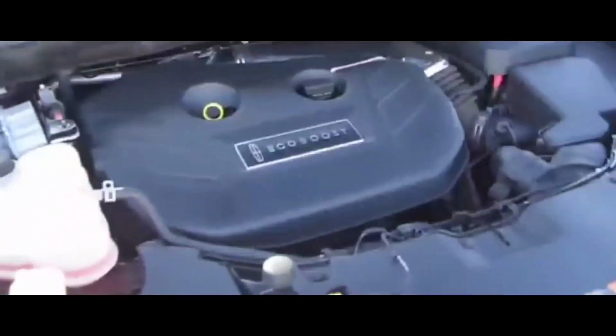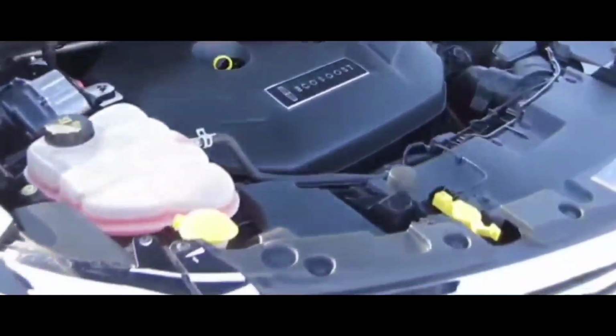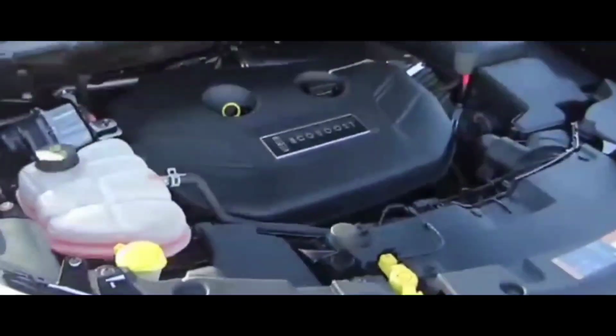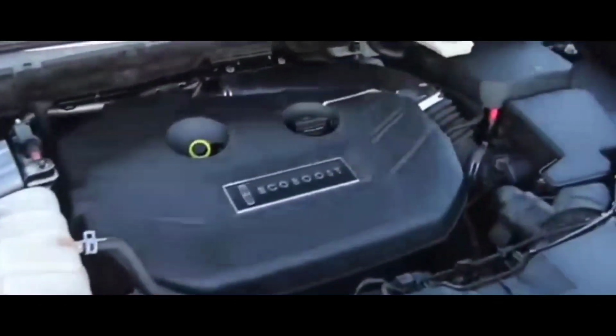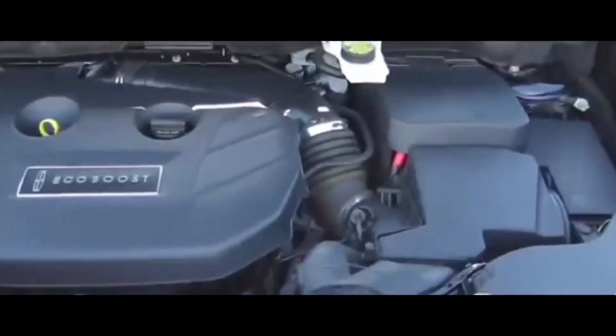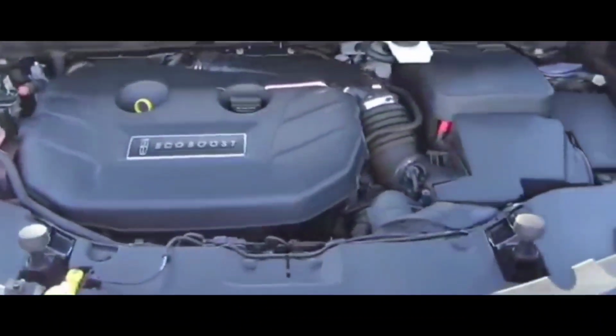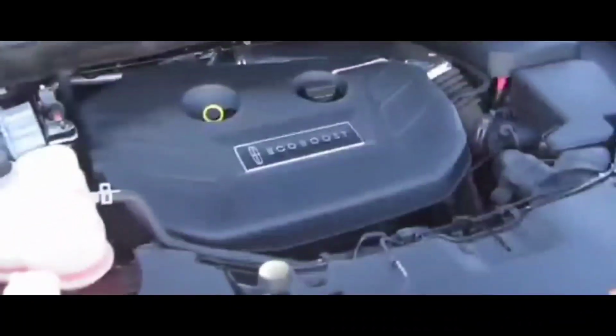One way is to disconnect the battery cable for 2 to 3 minutes and wait to see if the engine light comes back on. Upon reconnecting the battery, start the car. Drive the car for at least 10 miles for the ECU to learn. If there is an issue with your car, then the check engine light will come back on.